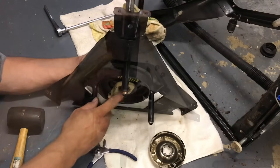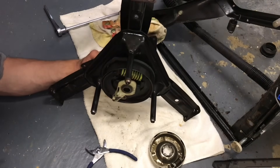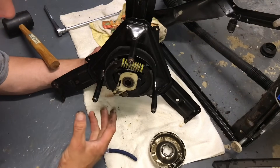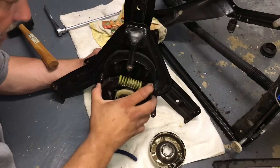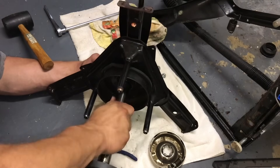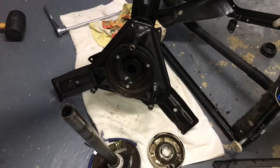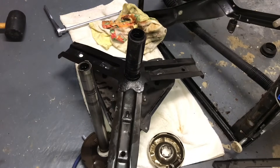Remove the shaft — I'm just going to gently hit the top of the shaft. As you hit the shaft you're going to see there's another braking system here with some brake shoes and a drum. This is actually the mechanism that causes your drum to come to a squealing halt when you open the lid. Ease that right on out. I'm going to remove the whole thing because I want to inspect the end of the shaft. There is the upper seal we're going to replace, and the lower seal is right here.